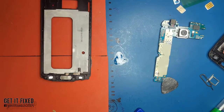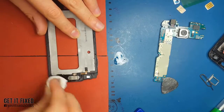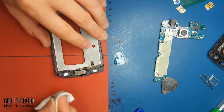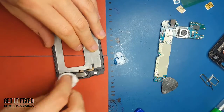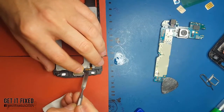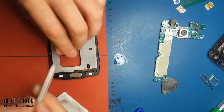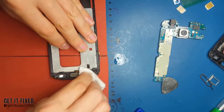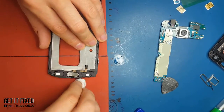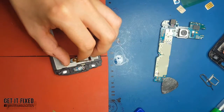It's called B7000 - it's a silicone glue specially made for LCDs. Put just a small amount in the corners. Don't put it near the home button because it will leak underneath and make it stiff. Don't put it near the top flex of the screen either, because if you want to remove it later it will be really difficult. I've done hundreds of these and this is the best technique I have.